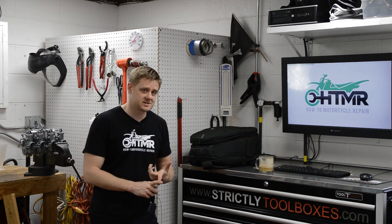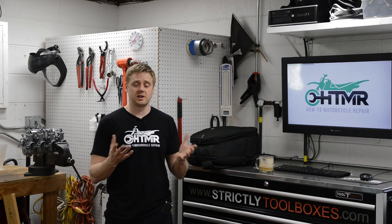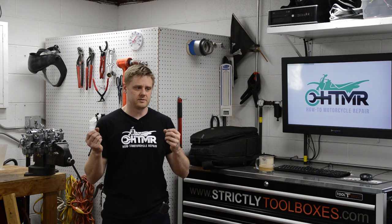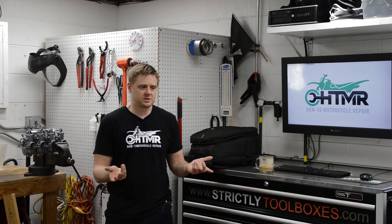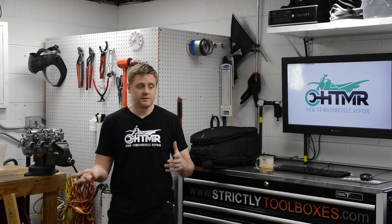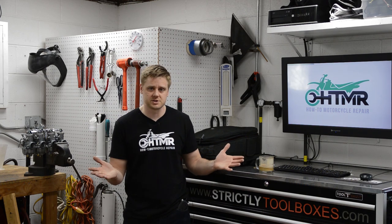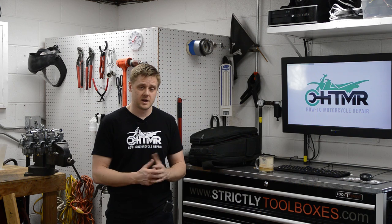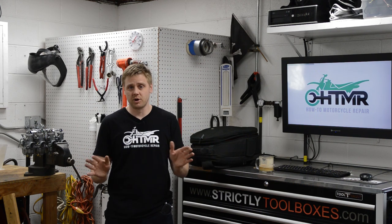And then there are some cases where you wouldn't want to vapor blast. For example, let's say you had a relatively new bike that's been sitting for 6 to 8 months or whatever, and the pilot jets are clogged. All you've got to do is take those carburetors apart and hit them with a can of carb clean and call it good. Vapor blasting it would be overkill. I mean, you would just create so much more work for yourself due to cleaning all the parts, right? So a can of carb clean or ultrasonic is perfect for that.